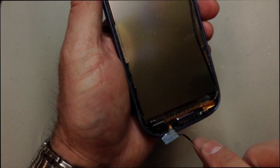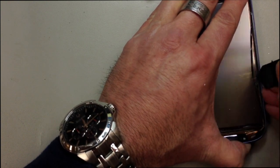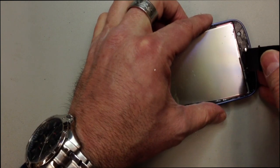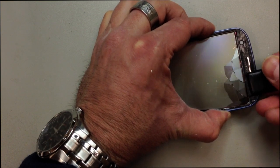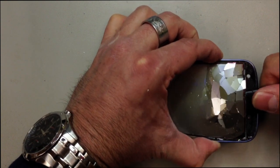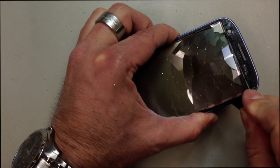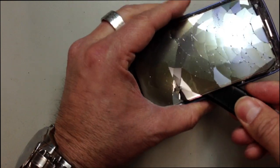You can see we've got the back and settings button there at the bottom on the little flex cable — don't worry about that, we're actually going to replace that entire piece. But if you want to, you can salvage it in case you need it in the future. Now I need to get underneath the AMOLED itself, and this is kind of the messy part because this thing will shatter into lots of pieces. You can apply a little more heat if you want to — it makes it a little easier to pry — but there's quite a bit of adhesive underneath this, so you have to really get under here and twist it with whatever you happen to be prying with. I like using the metal tool here, but as you can see it's just kind of shattering into pieces as I go along. Fortunately this is all organic material, so we don't have to worry about this ending up in a landfill and poisoning the water supply.